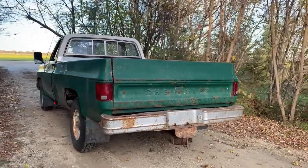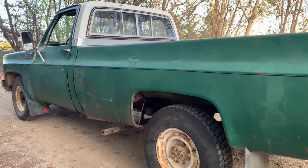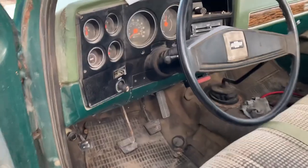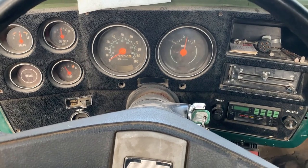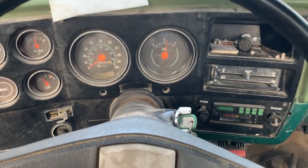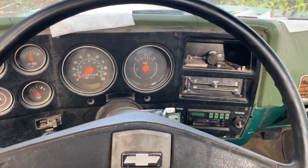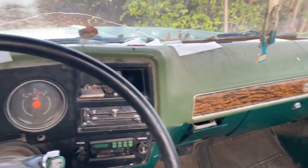And she's out. You know, it's running very good. We have pretty much everything we need, I think. We have 30 pounds of oil pressure at idle. Temperature gauge is just staying right there, which is nice. This thing even has heat, and she is working very well, like, whoo, 2 clicks away from the gates of Hades there. Got my brush back in. This will be a frosty night, so.